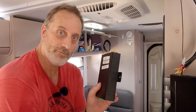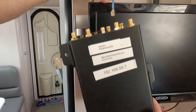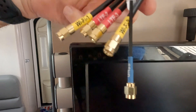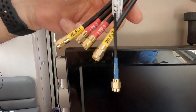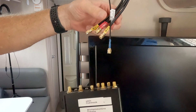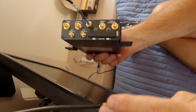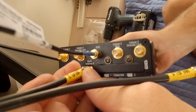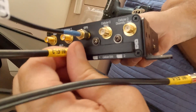The final stage is to take the PepWave router and tie it to the antennas. They're all marked both on the device and on the cables themselves. There are two channels for each cell signal, so four of those, and two Wi-Fi connections, plus one GPS. Just finger tight — you don't want to over-tighten these.